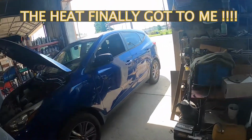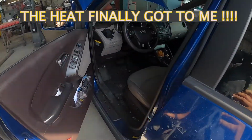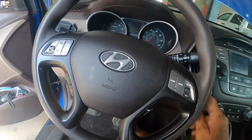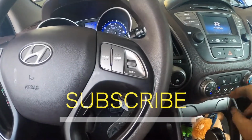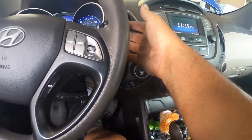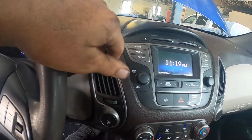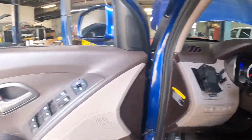We're working on a 2000 Hyundai SUV, a little Tucson or Tucson or Toucan or whatever the heck you call it. And the customer's complaint is no AC. So let's start this thing up. Let's crank up some AC and let's see what happens. Max AC, AC's on, max AC, we're in cold and nada. And there's definitely no AC action going on. Let's go out there and look at the compressor.